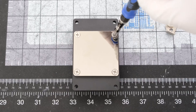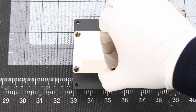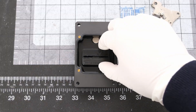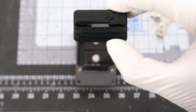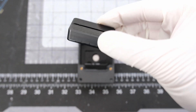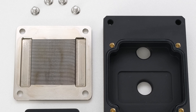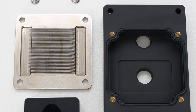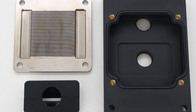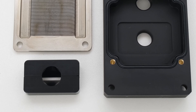Next, let's remove the four Phillips head screws on the cold plate, then lift the cold plate up and away from the block. From there, we have a look at the two-piece jet block insert. The pieces are made of polymer and mated together into a single unit, designed to create a smooth transition from the round inlet to the jet slot to maximize flow rate directly onto the fins. Currently, the Signature V3 is double the price of the Foundation block. The extra cost is primarily due to the size of the brass monoblock, the larger cold plate, and the polymer jet block insert. This is an enthusiast class product aimed at those cooling the most powerful 16-core CPUs on the market.